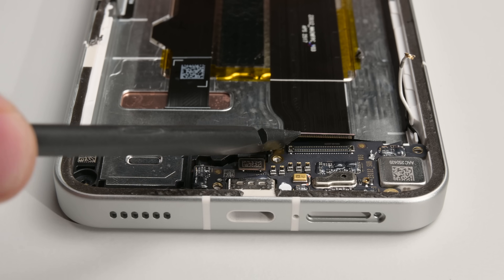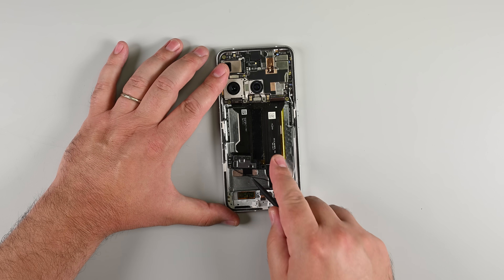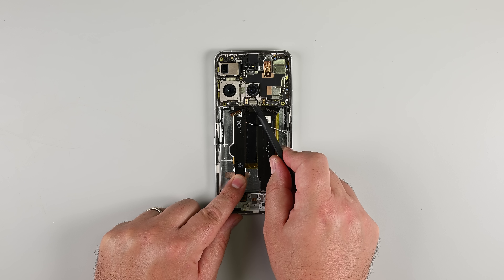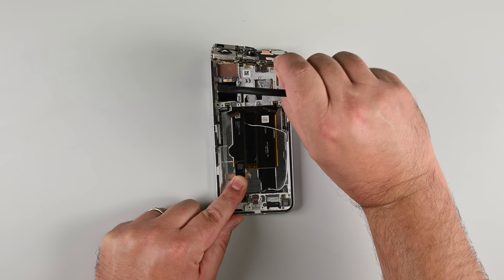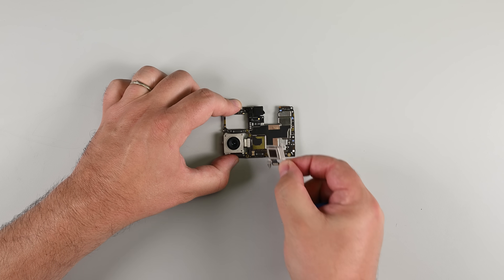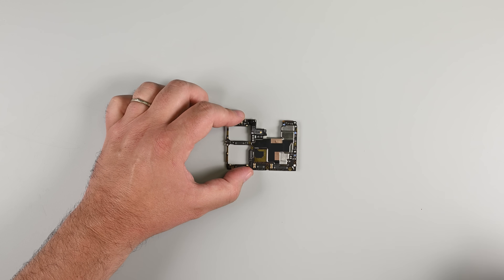At the bottom of the phone, I remove two screws, a couple of cables, and — surprise — another hidden screw securing the speaker and USB-C port. Turning our attention to the main board, I've got one last tiny screw up top holding it into place. This main board is home to the Snapdragon 8S Gen 4 chipset, and it can now lift right out. From there, I disconnect and remove the periscope telephoto camera, the ultra-wide camera, the primary 50-megapixel camera, and finally the 50-megapixel front-facing camera.